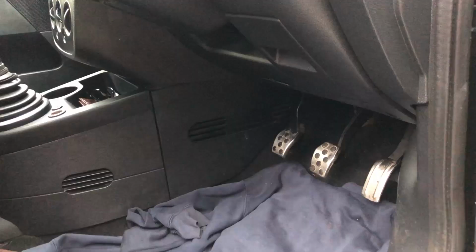I'm not 100% sure, but that is pretty much bang on our issue. I know that's the problem. I'm 99% sure that's what's causing it because it's such a common thing with these cars. How it works exactly, I'm just speculating based on my knowledge of electrical circuits, but enough about that. Let's get on and change this resistor pack out, and then hopefully I can actually clear my windscreen without deafening myself at the same time. Maybe a bit dramatic, but I don't want to drive around with it on number 4 all the time, and I know you wouldn't either, so let's get it changed out.